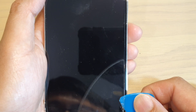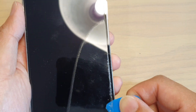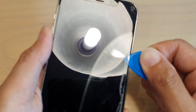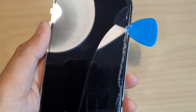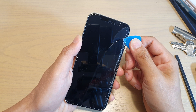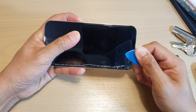It can be a little bit harder, more challenging. But in this case it's quite easy to take it out. You just have to move the prying tool upwards on the side. You can see the glue now starting to come off. I'm going to zoom out so you can actually see. Here we're going to pry it around the edge of your iPhone — this is the iPhone 12 Pro I'm holding.